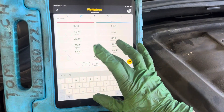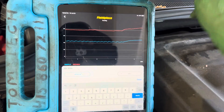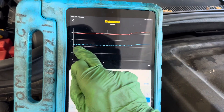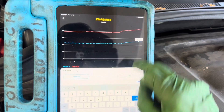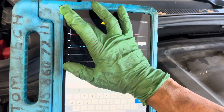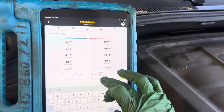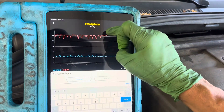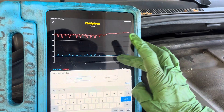So now we're loading the system. And if you look at the dash temperature coming out of the dash, we went up — we're no longer cycling. You see the cycling of the clutch? We're no longer cycling. Now we're at 50 degrees. And if we look back at our pressures, we're back up at 171 — you see how it's still gradually going steadily up, and so is our temperature.